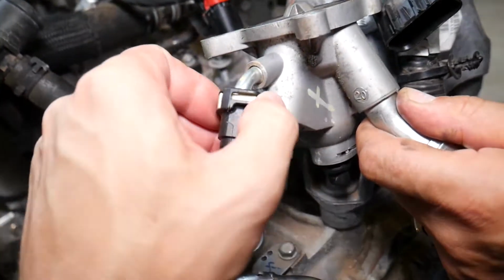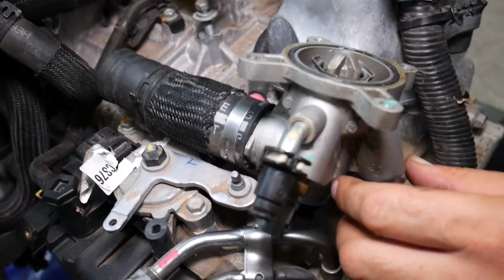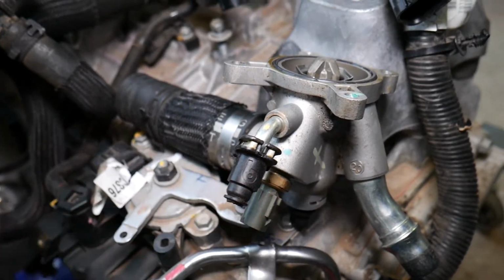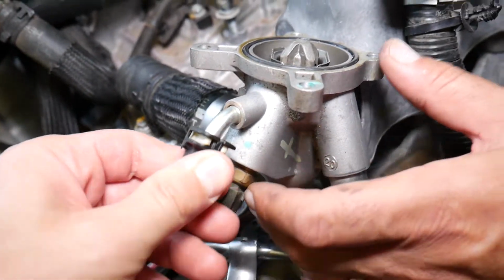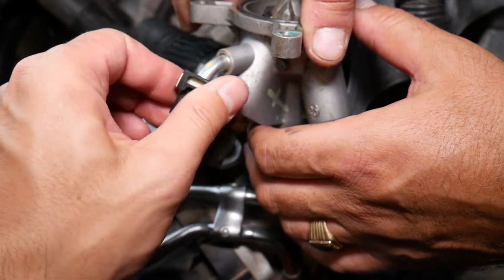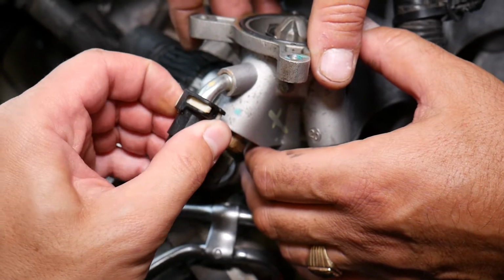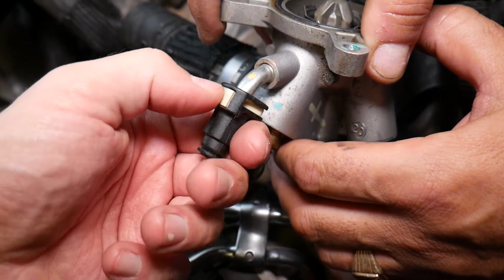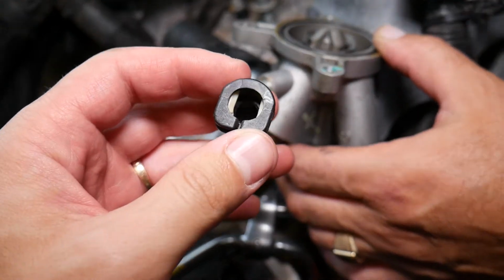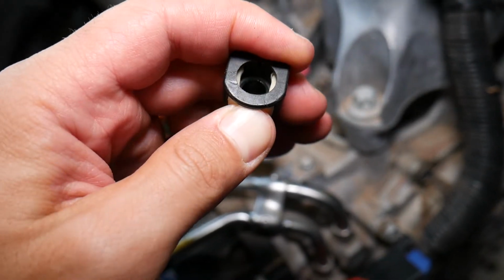This hose now right here, guys, it's supposed to have a safety lock. We'll grab one and I'm going to show you what it looks like. This one somebody broke, but it's supposed to be blue in color, guys. We're going to remove it and I'll show you how to do it. So once you guys put the thermostat to the side, let me show you what needs to be done now. This thing has an O-ring, so it will get stuck really badly, especially if it hasn't been removed. Move it left and right a little bit. When you have the hose attached, you'll be just able to go a little bit. Now you need to push in here. Check this thing out. Push in and start pulling out gently. And this is it, guys. When you push in, it releases the pipe. You can see like that.